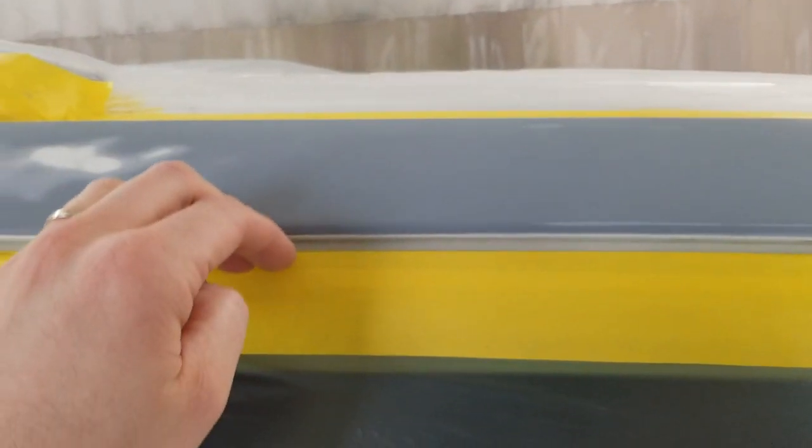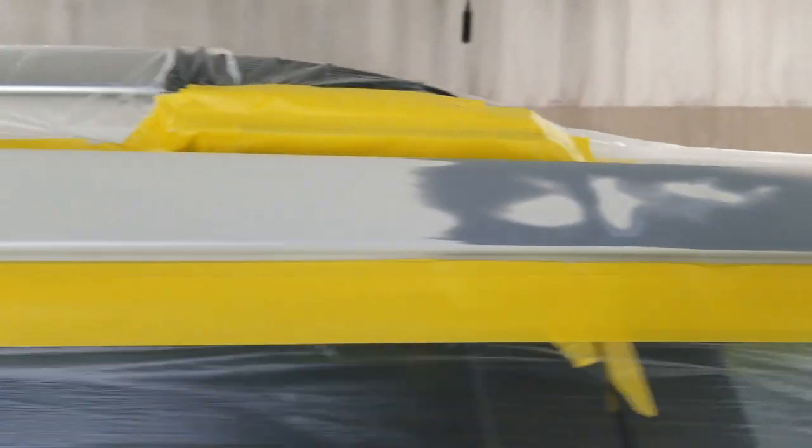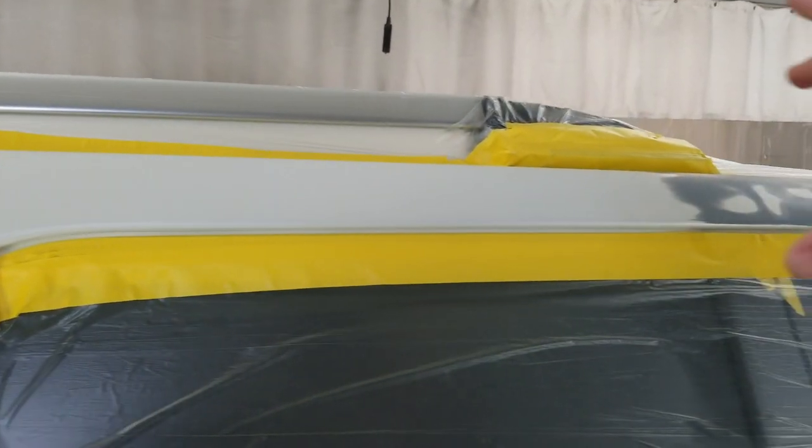And that door is actually not sealed to the foam tape, but I've got the top edge of the door down in there and the body all the way down to the actual water seal taped off, so it can go down inside here, but it's not going to get on anything. That foam tape's just there to give me the soft edge that I need inside the jamb. So the plan's going to be to coat this area back here with 222S to give me a wet bed,